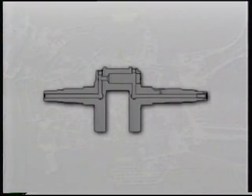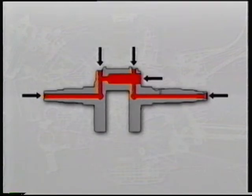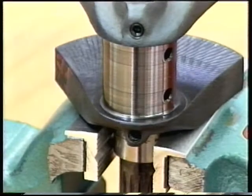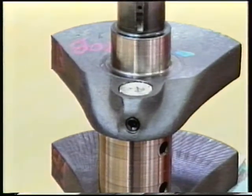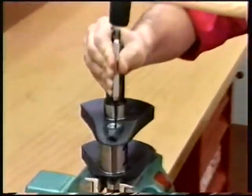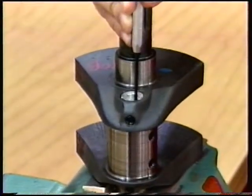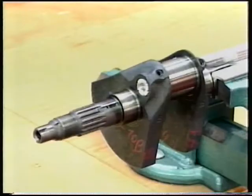Clean the crankshaft oilways using wire brushes of adequate diameter. Renew the aluminium cap and refit the caps after applying high-strength thread locker to the threads. Screw the aluminium cap fully home and then cork it. Tighten all M8 caps to 30 Newton meters.